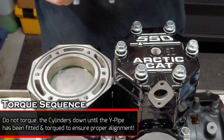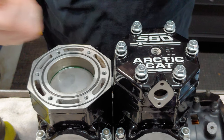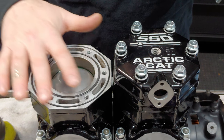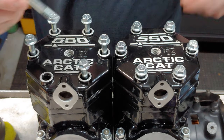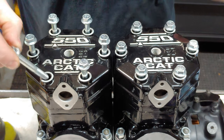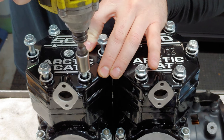I got the new head gaskets on there. Sometimes the center one fits pretty good, but the outer one you typically will have to stretch a little bit. Just be careful — you want to make sure these gaskets are sitting in the groove they're supposed to sit in, not coming outside of it. I ended up putting a little bit of oil on each one of these O-ring gaskets so they slide. This is the tightening sequence order. You don't have to do it now.